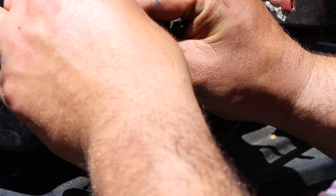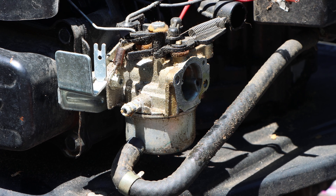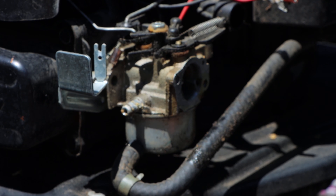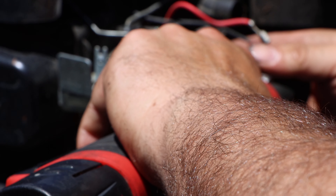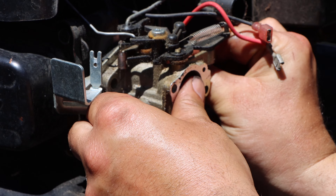Using a simple set of pliers, we are backing off the hose clamp for the fuel arm. Give that hose just a little bit of a twist and a pull to break that seal, and it will come right out. You can see a little bit of buildup underneath the fuel arm. Here I am just looking at the governor spring, seeing where the exit hole is. Nice and easy, out it goes — do not stretch that. Now it's time to take off those carb studs. They are the same exact size, which is pretty interesting — usually they're two different sizes. Same size for the intake filter, same size for the carb. Now this carburetor will come off.